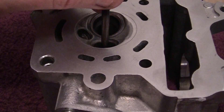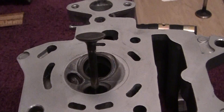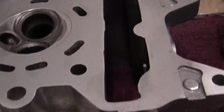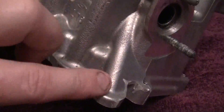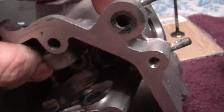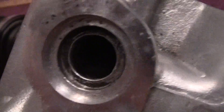Before I put this back down in the valve guide, let me show you why the engine failed. In the exhaust port there is a tiny pinhole — I don't believe you can see it, but we talked about this before. This is the pinhole port right here; you can see it's kind of rough right there. It's a small, tiny port that goes right into the exhaust valve, right down in here, and there's a little hole.